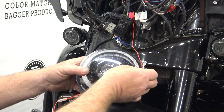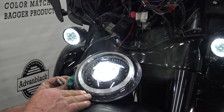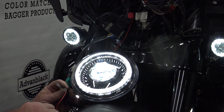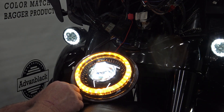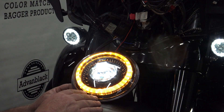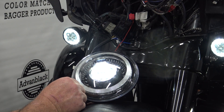It doesn't change whether or not you hit the brights. Now, on the back of the headlight you have a red and a green wire. When you plug into the red wire, it's going to turn all of those lights on in a sequence and then turn the white halo on. On the green wire it's just going to be amber — there's no sequence or anything like that, but it turns the ring amber. I really do not recommend running the amber with a central headlight setup — that would be more like for a turn signal with a two-headlight setup. So we're not going to use the green; you're going to plug into the red.